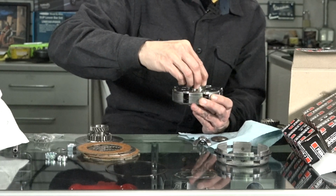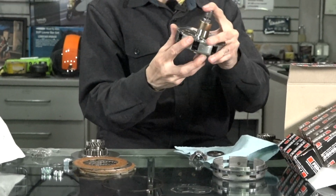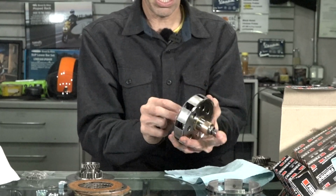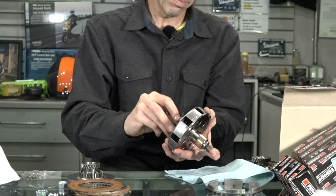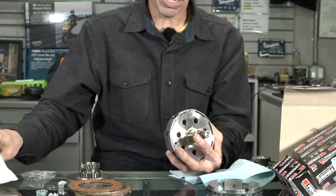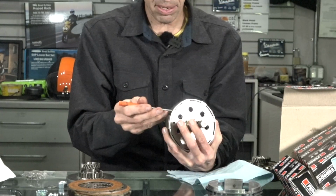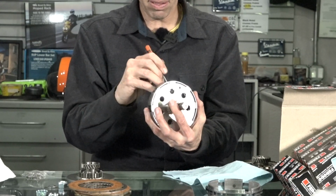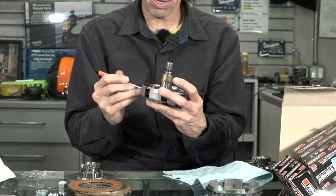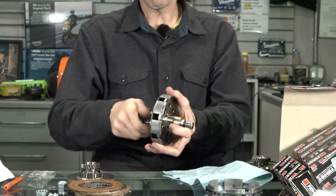And before you go too far, I'll put the tool in here. There's a little trick. You just don't want to start cranking down on this all the way. We're going to leave it kind of where it's just keeping a little tension on the clutch. So just a little bit of tension. You want to get your little screwdriver in here and click these springs all into the grooves, so you can kind of drop them in. So there's 3. Of course, they're staying in these little cups. That's not a problem there, but you can kind of see down the holes as well. And at this point, let's go ahead and crank this all the way down until that bottoms out.